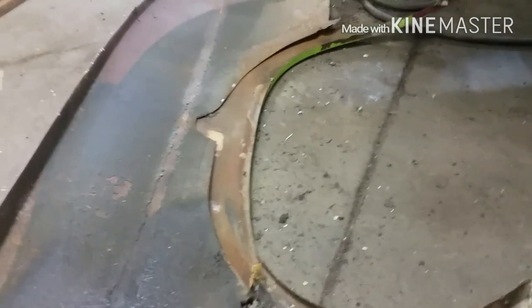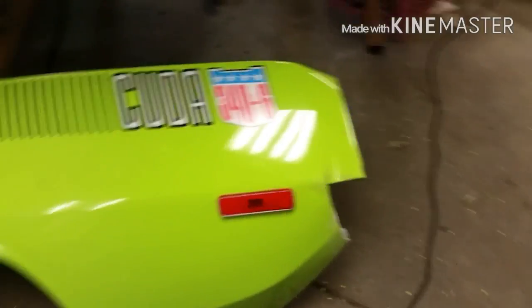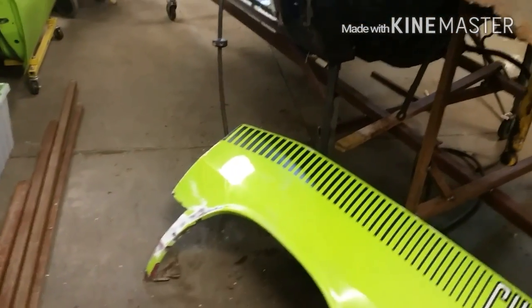I've got the driver's side quarter off. I was wondering why I couldn't see a seam when I looked in the inner fender — I thought it was just damaged, but now I realize that's where the new quarter was welded on. It still had the original undercoating, but the new quarter starts there — it's just the lower half welded over top of the old fender, which is fine, to be expected on this car. I cut the top edge, started cutting the back, and the whole thing just fell off. I think this is going to make a nice piece of wall art.